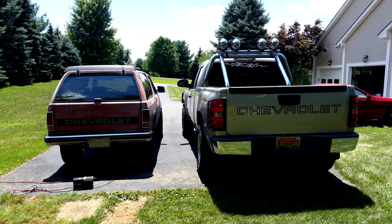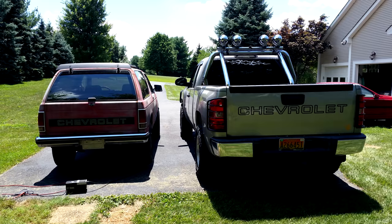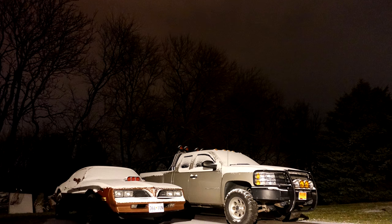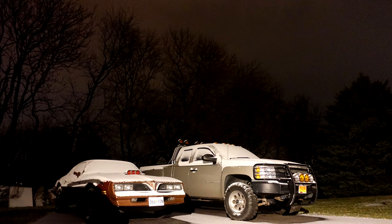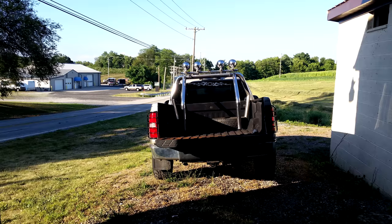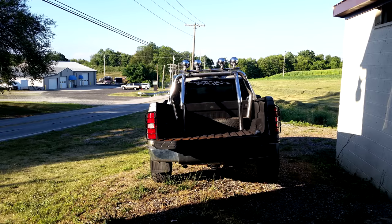But the biggest concern is that the truck started to act funny in reverse. One day I was backing up a steep hill and there was a massive clunk — the whole vehicle shook, but then it kept going. I got out and looked to see if there was a big hole in something underneath the truck but didn't see anything wrong. This problem persisted for the next two and a half years, getting worse and worse over time. Eventually I couldn't give it any gas in reverse without the clunk happening. The only way to reverse up hills or on uneven surfaces was to put the transfer case in four low and crawl. At the time I was pretty convinced it was the splines stripping out of the sun shell in the transmission, but I kept on driving it anyway.